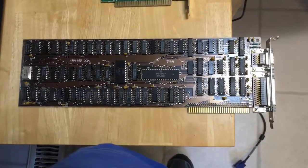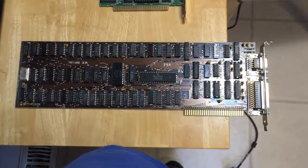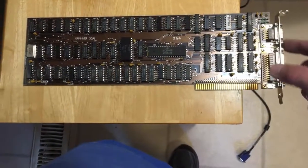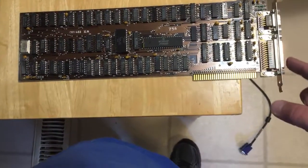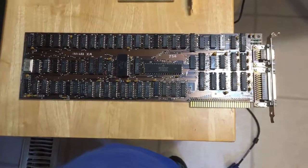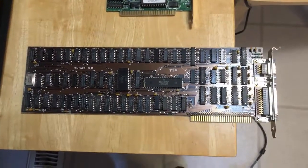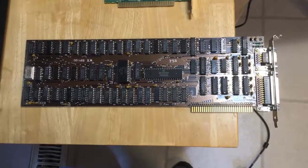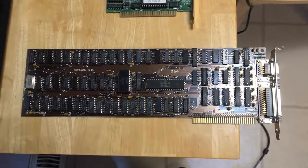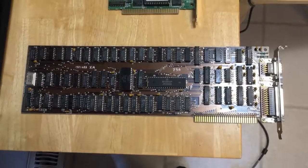I've had a look at it and it is MDA — monochrome display adapter — original to the 5150. I don't think this has been upgraded through the life of the machine. You have an MDA connector right here, it's 9-pin, and you also have a parallel port — they bundle those together for whatever reason. You'll notice this machine has no built-in ports aside from the keyboard and cassette ports, so nothing was built into the motherboard; you had to put all your input and output on different cards.